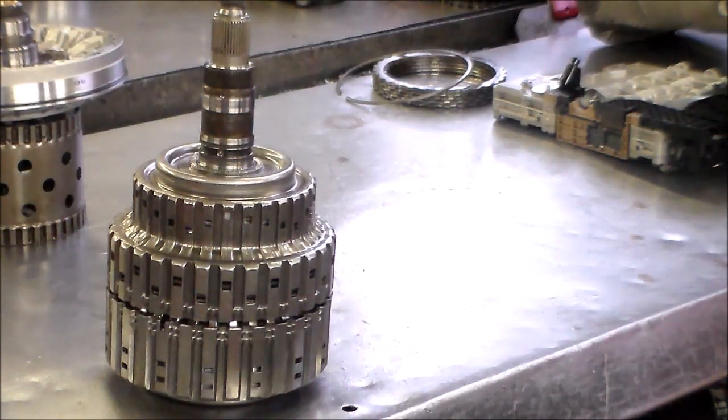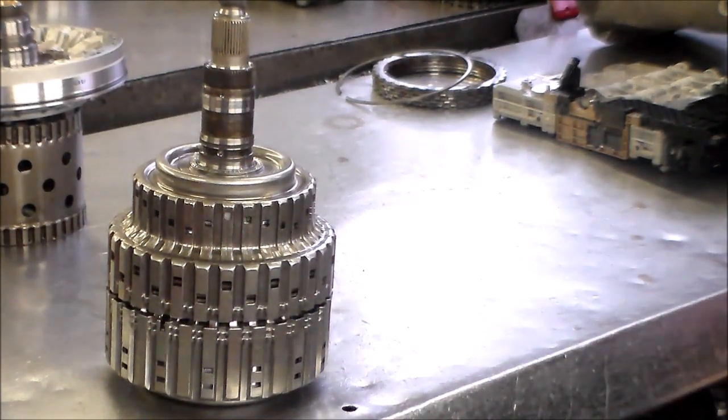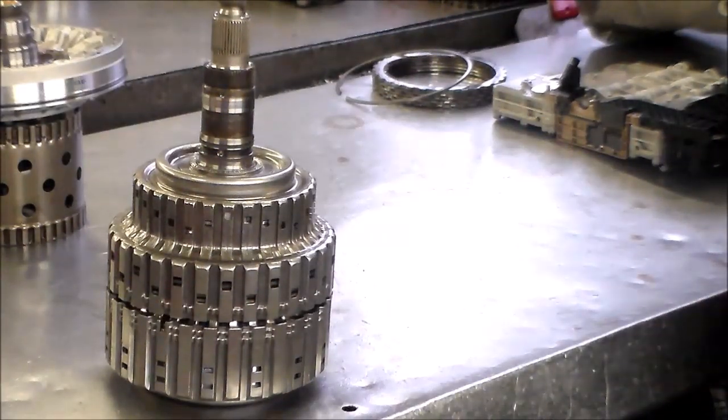All right, so just a recap on this 2006 BMW X5. Came in with clutch E monitoring originally. Talking to the customer, he did want to fix the car ultimately, hoping he wouldn't have to spend a lot of money. So I said, hey, let's try the valve body first. So we agreed to that, and we found those dampers no good. We put new solenoids in. He already had done the bridge seal, sealing sleeves, filter, fluid and gasket, because this does have the metal pan.